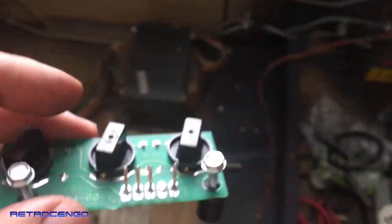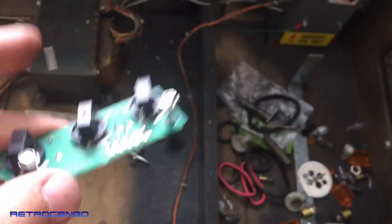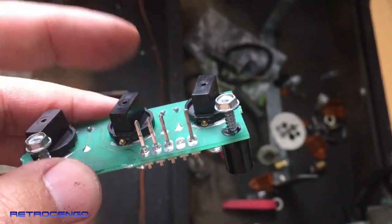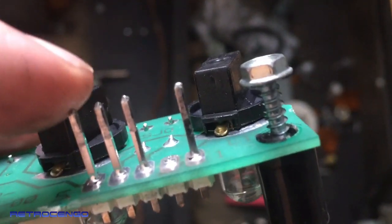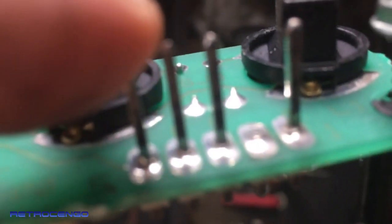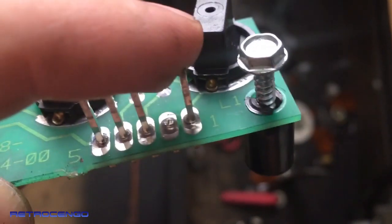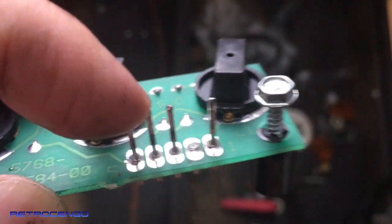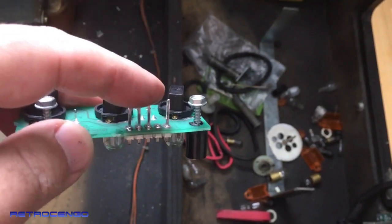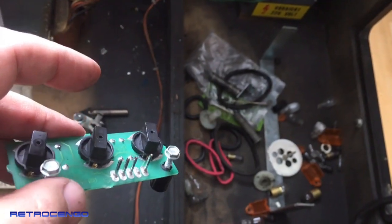So what I'm going to do is, you can check a lot of stuff, but one of the main issues with a 30-year-old game is stuff like this. Cold solder joints. When they're flaky, you can actually, I don't know if the camera can pick it up, but can it zoom in? No, it can't. Can you see here? I can wiggle everything. So the boards will be like this. They work sometimes, and when I touch the cables, it will work. As soon as I just move my finger again, then it will just go dead again.